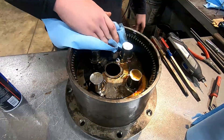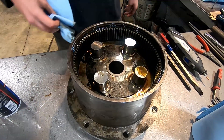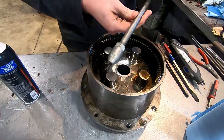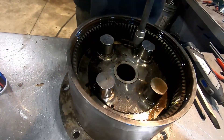There's internal threads on those nut pins — they're standard 5mm threads. On motors that are dirtier than this, it's best to try and get a pick in there and make sure that all those threads are cleared out. You can use a pick, some air, whatever you've got laying around. I used brake cleaner there because I just had some oil in there.